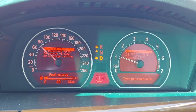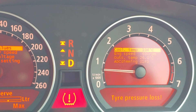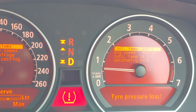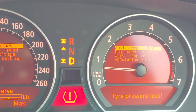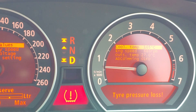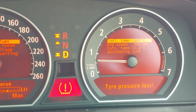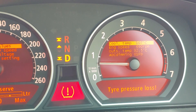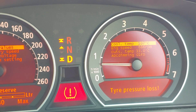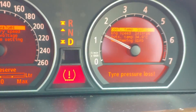I purchased a generic thermostat off Amazon advertised as having an opening temperature of 95 degrees. Looking at it now, it definitely does not meet that specification — in fact it's pretty much the same as the OEM opening temperature. So either it wasn't calibrated correctly or it was an incorrect advertisement. This is the thermostat I got, and what I'm going to do now is modify it to try and lower the opening temperature.